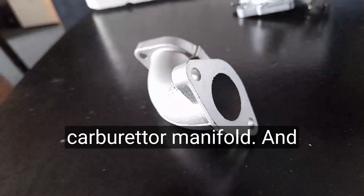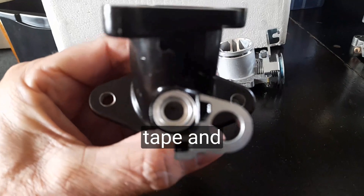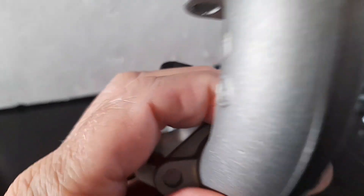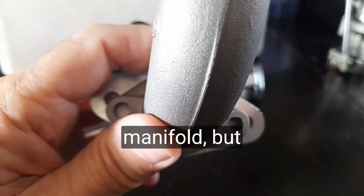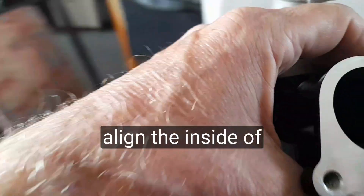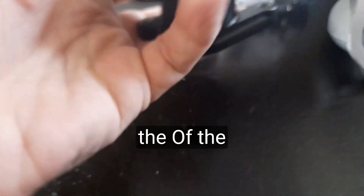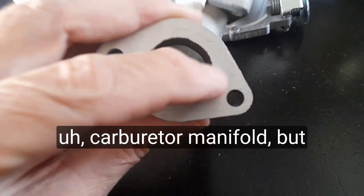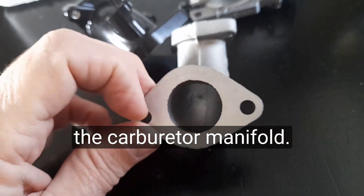What I can do is put double-sided tape on the manifold, align the two together with the tape, and then drill through the carburetor manifold to fit the two screw holes for the fuel-injected manifold. The main thing I have to take care of is aligning the center of the port as close as I can to the center of the carburetor manifold — though the holes are not in line with the center of the port on the carburetor manifold.